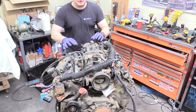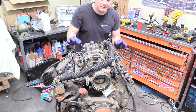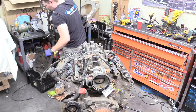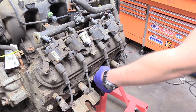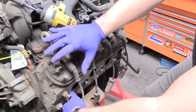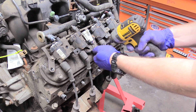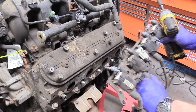With all the little plugs and 10mm bolts off the top, we can remove our wiring harness and keep it just in case we need some of it later. It's better to keep it and not need it. Next thing we're going to do is remove our whole coil pack assembly. Go ahead and remove the spark plug wires so it all comes off as one unit. Then remove these five fasteners — 10mm, you're going to need a deep well socket — and this whole thing comes off. Do that for both sides.